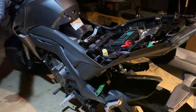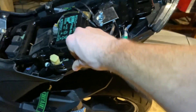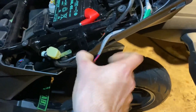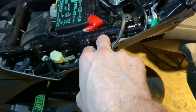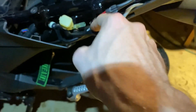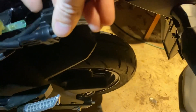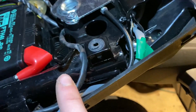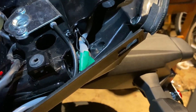Set that off to the side. Now with the side off, you can see all the wires. Take this connector here, push down on it, and pull off to the side to get it off. Once you have that off, your license plate light is going to be under there — just move it out of the way. There's going to be a little rubber boot around it. Push down on it and pull out to disconnect that. Your license plate light wire runs through here and down below; you're going to want to disconnect it and get it out for easier access.